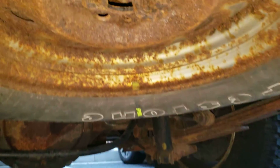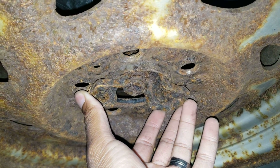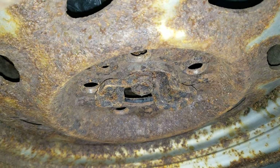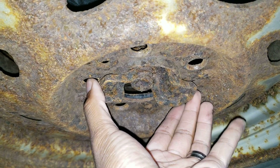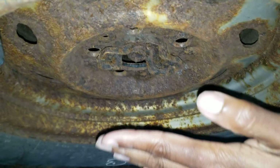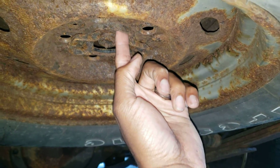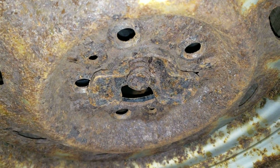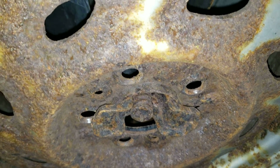And once you have it down, this center piece right here is on a cable that you're loosening up when you turn that rod to the left. When you got it 5 or 6 inches off the ground, you're going to need 2 hands. One strong arm to hold the tire up, and then this bracket will flip 90 degrees where it's vertical. Right now it's horizontal. You're going to want it vertical. And once it's vertical, it'll slide right in this hole, right in the center of the tire. And then you got it off. And then you want to make sure that it's not left hanging close to the ground where it can catch something. So you roll it back up a little bit.